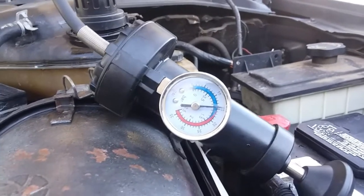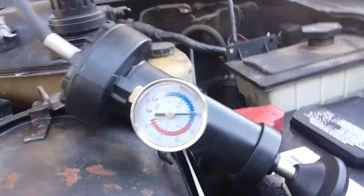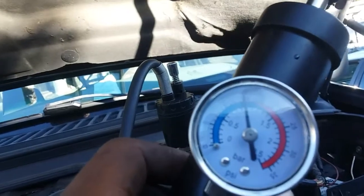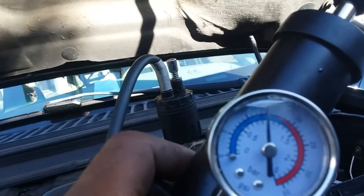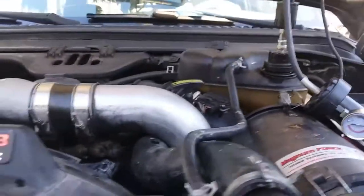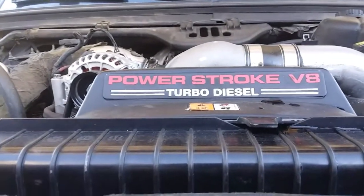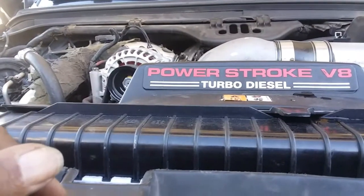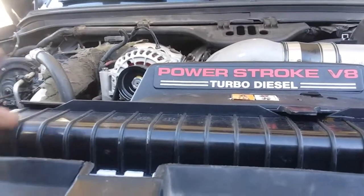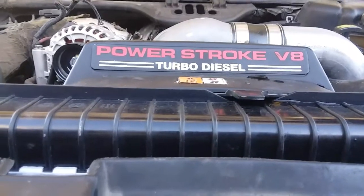This is something I prefer to do when I finish anything involving the cooling system: pressure it up and let it sit for at least a good 20 minutes to make sure I don't have any leaks. That way I know it's good and it's not going to be a couple days later with the coolant low and something messed up. I prefer to pressure test and make sure it's good when I'm done — no leaks.